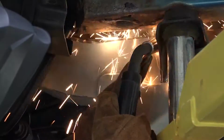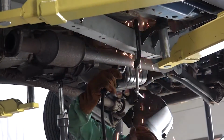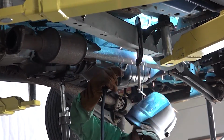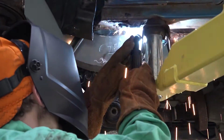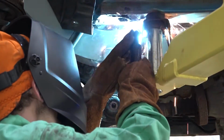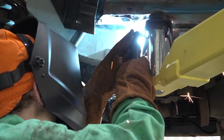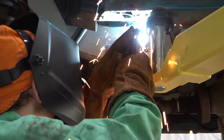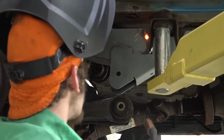Step 7. Remove any remaining potential fire hazards on both the vehicle and surrounding area. Following proper welding procedures, begin welding the part onto the frame rails. 100% weld around all edges. Step 8. If you chose not to protect the part in Step 6, coat the part and work area with a primer or other rust inhibitor.